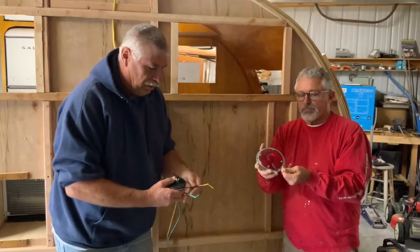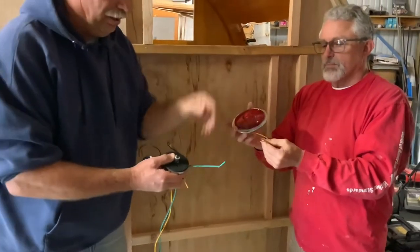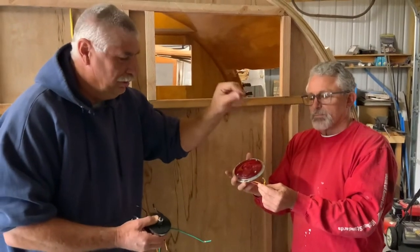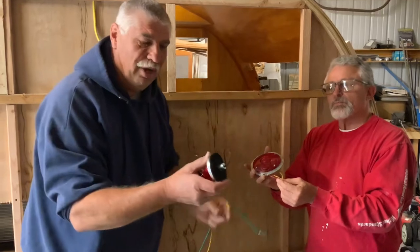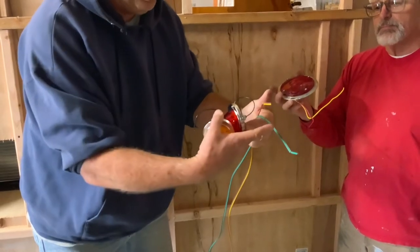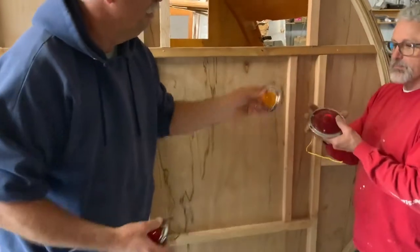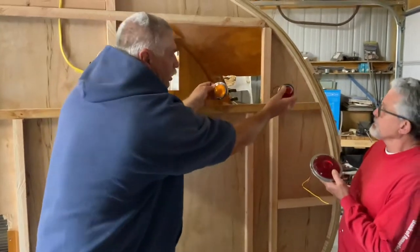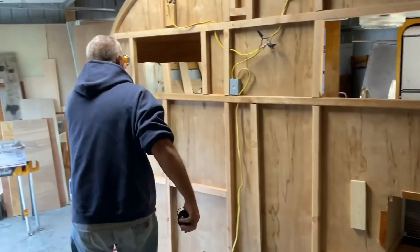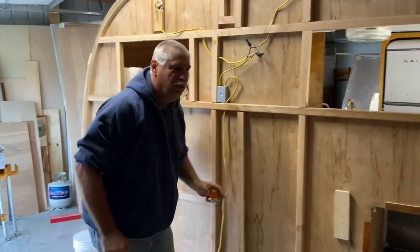The right side is a green wire and when you turn your signal on, that's why it's brighter. The brown is a running light and it's dimmer. There's only one wire on the side marker lights — that is for the hot, which is your running lights. When you turn your parking lights on, your side marker activates. The national code is on the back half you put a red clearance light, on the front is the amber. Amber on the front, red on the back, and your tail lights are red.